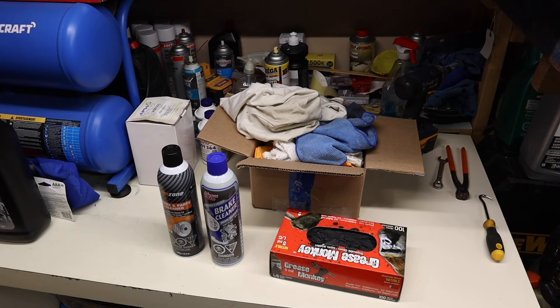I don't have a picture of the before, but what you need to do in order to diagnose where the leak is coming from — whether it's the diagonal split on the rear diff or whether it's from the axle seals — you're going to need at least two cans of brake cleaner, a container to catch stuff, a piece of cardboard underneath the car, some nitrile disposable gloves, and at least three or four microfiber rags. Use the ones you save from other projects because you're going to have to trash these. You need the gloves especially because everything's tight down there; you're going to sometimes have the microfiber on your hand going in between different arms and stuff in order to clean everything around the axle seals, because it's very hard to get the brake cleaner in there. Spray it and go with the microfiber towel and continue until the entire diff is clean.